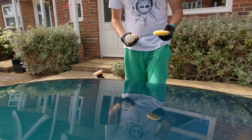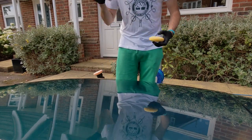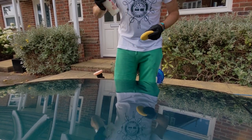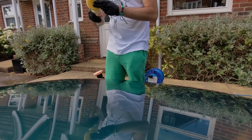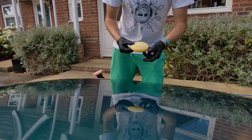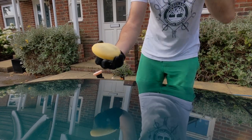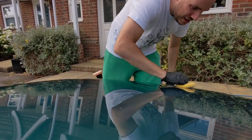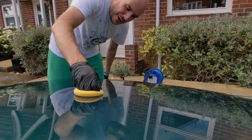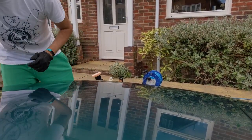One last stage: LSP — last stage product. In this case it's wax, and in this particular case Collinite 845. Love this stuff. Really easy to apply, gives a wonderful colour — good protection, but a lovely warm depth of colour, which I think this lovely green paintwork deserves. If you've never seen wax being applied before — look, there's hardly any wax on this applicator, and this could be enough to do the entire bonnet. Start in one corner and work your way around.